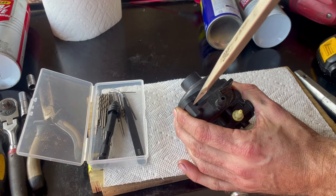We'll clean off the outside to make sure we don't introduce any contamination, then clean out the inside with some carb cleaner. Now we're ready to put this back together. Make sure to get the orientation right — this little raised box here needs to go over that. Do not put it on the wrong way or you'll damage something. Make sure that box is leaving space for that, then put it right back on there.